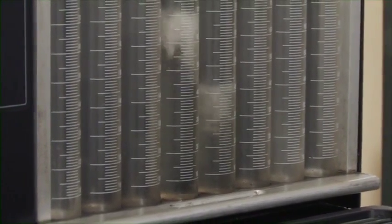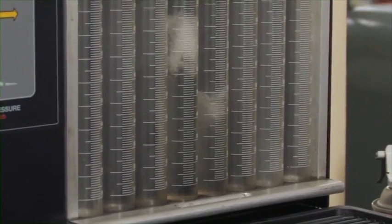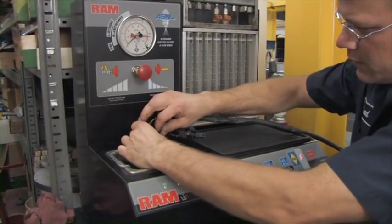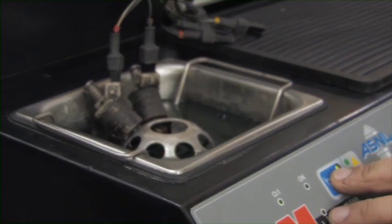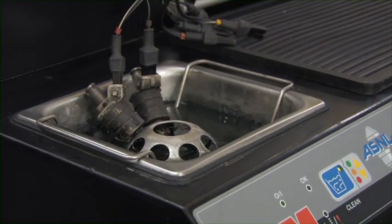When an injector is clogged, it will typically cause a drip from the injector, allowing raw fuel to run into the engine. The raw fuel dilutes the oil, causing premature engine wear or total misfire. It is recommended to have your injectors tested anytime you remove the heads for valve work. Engines with misfires typically have a bad injector as the cause of the problem.